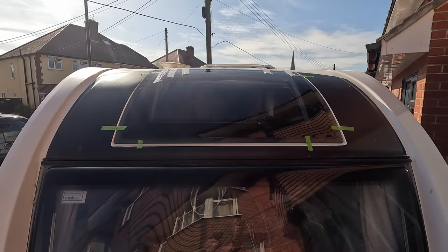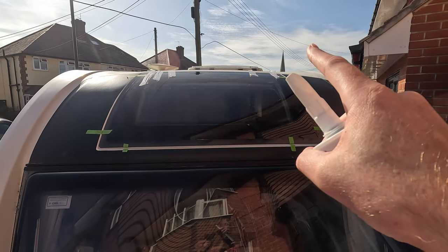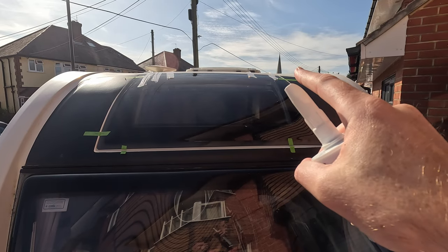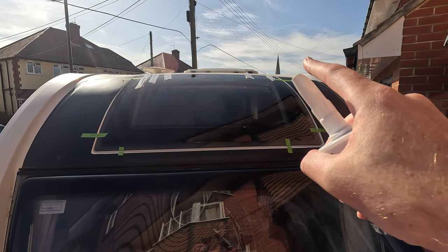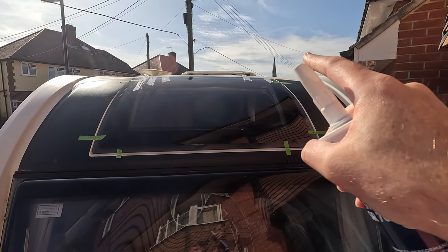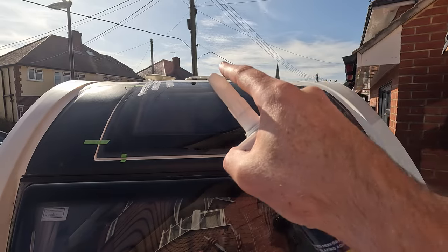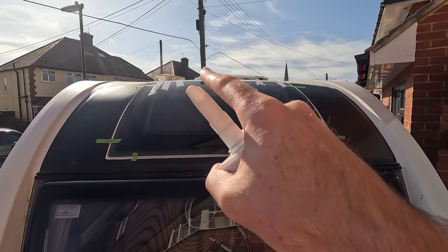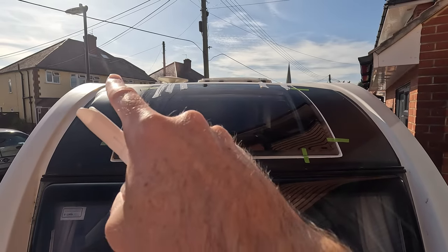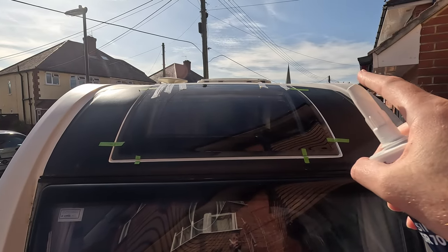as you need. What they've changed on this now is the way they do the top. So the top line up here, they actually fill with silicone now, which I think is to help cracking in future, and to try and eliminate that. There was a stage where they used to come down 50 mil as well in the corners, but I think the recommendation now is you just do the top. So you mask that up completely, fill it, wipe the excess, and then remove the masking tape, and that just leaves you basically filling the gap right at the very top, but only at the top.